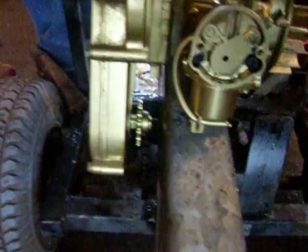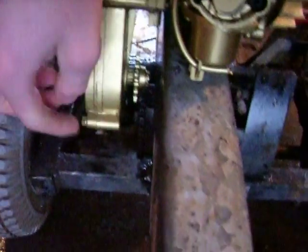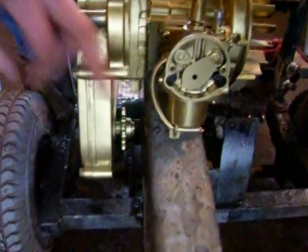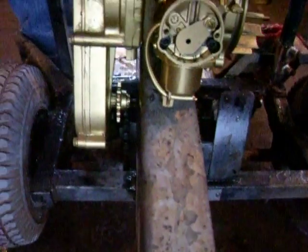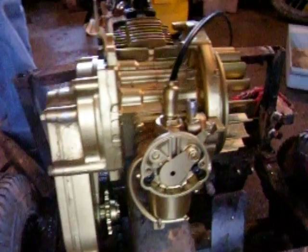It's just the ones that come on there. As you can see, this is the sprocket that's on there. There's a different sprocket down there — you can't really see it that well. But we're just going to weld another sprocket that's the same as this one on the one down there. We're going to have to cut a piece out there for the carb too, just so the motor will sit on the mount. We might weld a bar up to this top mount too.